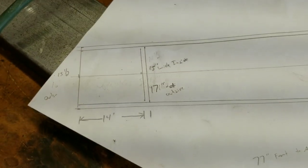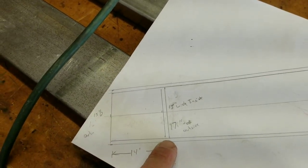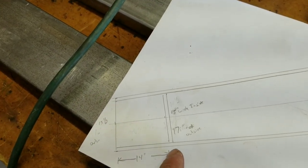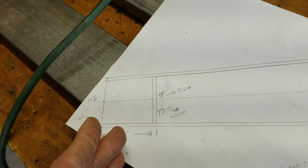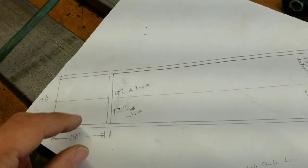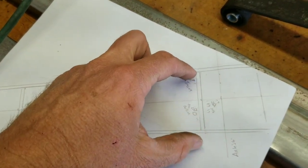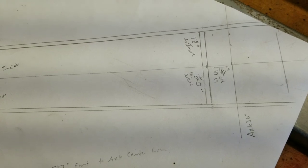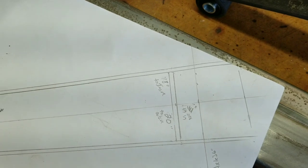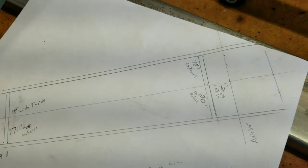The front cross member is 15 inches, and I'll show you the drawing. I'm modeling after my existing cart. The front of the frame is going to be 15 and a half to 16 inches wide. The front cross member is 14 inches back from the front — that gives the axle room to move. If you put the foot box on top of the axle it can interfere when the axle bottoms out, so you want it back about an inch from the centerline of the front axle swing. That's 15 inches on the inside, 17 inches to the outside of the frame rails. The back cross member is 18 inches long side to side, 20 inches to the outside — about what my existing cart is.